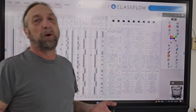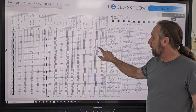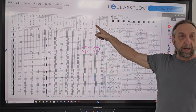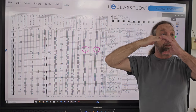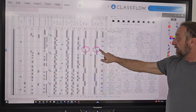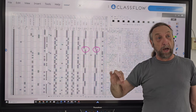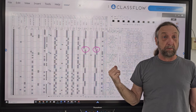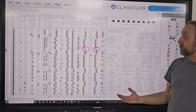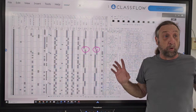If you find the switch closed, don't worry about it. There's no way it is possible for both of these switches to be closed at the same time. Why? Because they're both on the same cam, and the switch can either go top of cam or bottom of cam. There's no way in a timer all three can be closed. And if both of these are closed at the same time, that means all three would be touching at the same time. It's not possible. But if you happen to find one of them closed at that moment in time, it wouldn't be wrong. Okay? Why they draw it that way, I can't answer. But they're just saying it may or may not be closed. If it is closed, don't worry about it.